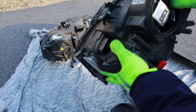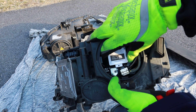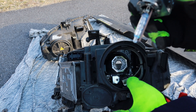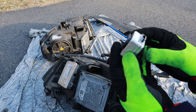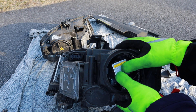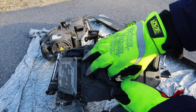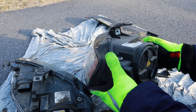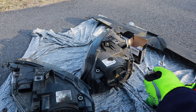To remove the actual bulb, first you want to unplug it, and then turn counterclockwise. It should pop right out depending on how much buildup is on the light. That's only a slight turn and it should pull right out. Now let's get the new 8K in. They look very similar, but the Philips on the right seems a little sturdier. Remember, it was a slight quarter turn — make sure it doesn't touch anything. When you put it in, it's going to be clockwise. Feel it lock in. You might want to plug this in first, but actually it was quite easy — it snaps right in. Good to go. On to the next one. Before I do that, let me put this cap back on — that just snaps right back in place.